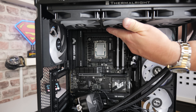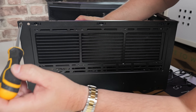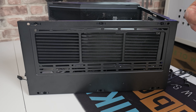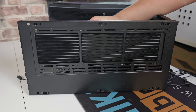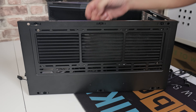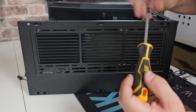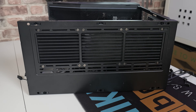You can then put some screws into the radiator at the top. I've put the computer down on its side just so I don't have to fight with gravity. Get one screw started and do it up reasonably tight, then go to the exact opposite corner and put a screw in there as well — don't fully tighten it yet. That will allow you to have a little bit of movement from side to side to balance things up or make it look neater. Sometimes the holes aren't particularly well lined up, so you can get one of the more central ones done. Once locked in place, attach all of the screws to hold it firmly in place.